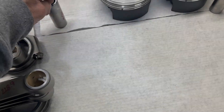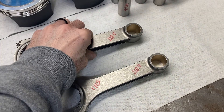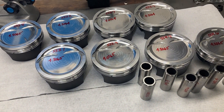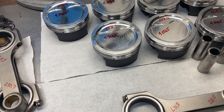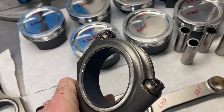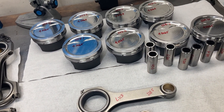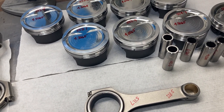Let's take a look at our rods. We got everything weighed — rods weighed, wire locks counted out. Right now we're just going to mix and match pistons, pins, and rod little ends until we get even measurements across the crank throw. We're trying to keep from taking metal off, and it's usually easy to just mix and match components because they have a little bit of different weights on the pistons, pins, and rods. It'll take me a little bit, but once I get everything numbered we'll start assembly.